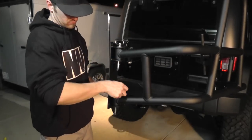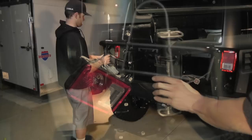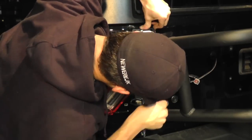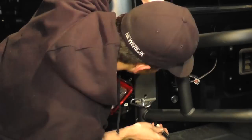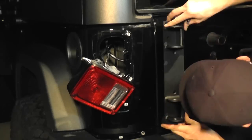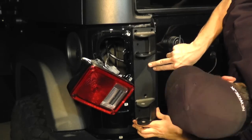Close the carrier to set the latch plate location on the rear of the vehicle. Mark each bolt location accessible while the latch plate is on the carrier cage. Then remove the latch plate from the carrier cage and mark the remaining hole locations on the body.